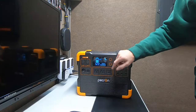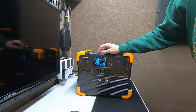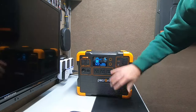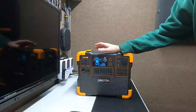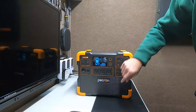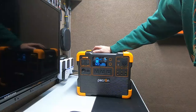Here's your 53. Now, remember, that looks high to you, right? That looks very scary high. Oh, because you're pushing buttons already. Careful there. Oh, gotcha. Okay, well, this looks high, guys, because this is a 48-volt battery pack now. So what happens is the other one is a 24-volt battery. And if you have an older system and you go and pick up this one, guys, do not put the EB3000 batteries hooked to this or you will have possibly a fire. You'll definitely have a problem because you don't want to mix voltage like that.